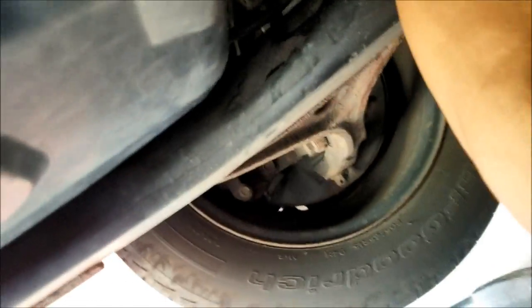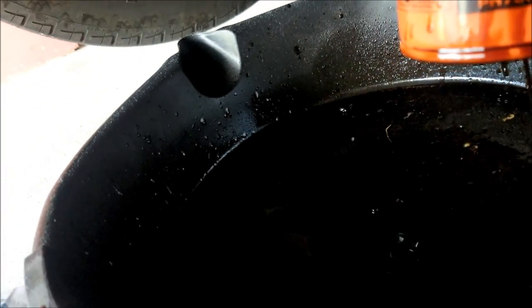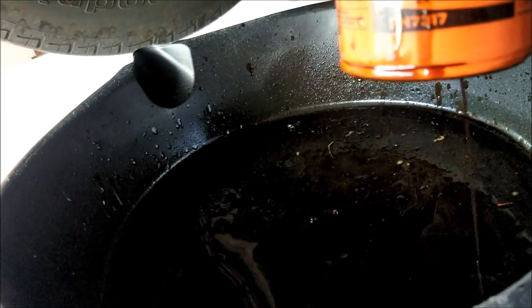Make sure your cover is good. I like to do the oil filter first personally. Twist it counterclockwise — keep going counterclockwise. There we go. As you can see I've used the Fram Extra Guard — I'll put a link in the description. This is the 2.4 liter by the way, not the 3.0.